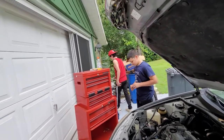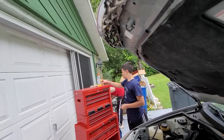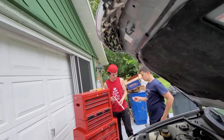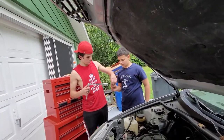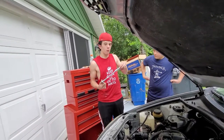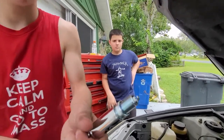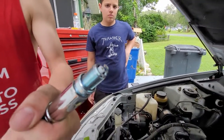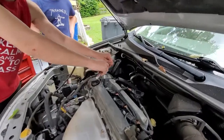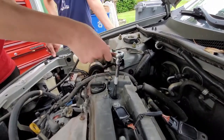Just a little interesting fact: I had started the car up right before I was going to work on the engine, so now all the metal pieces are very hot, especially the spark plugs — and I just touched it in the video. We already gapped all of the spark plugs, so just make sure you do that before you start. You want a nice gap in between that metal piece and the part that is the actual spark plug. Put it in nice and gently, because if you bend the tip, you're going to ruin the gap that you just created.